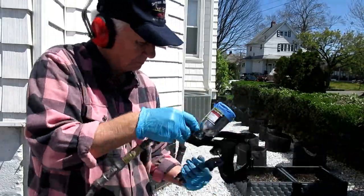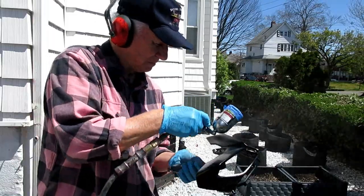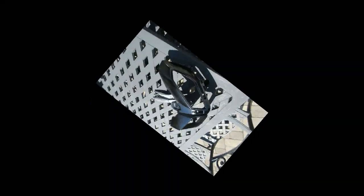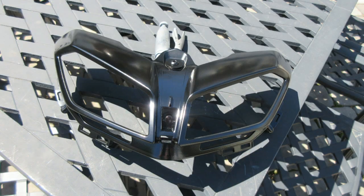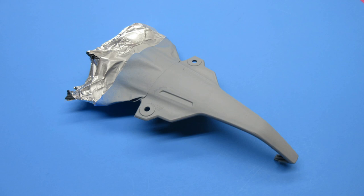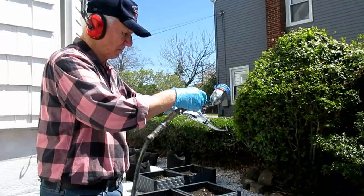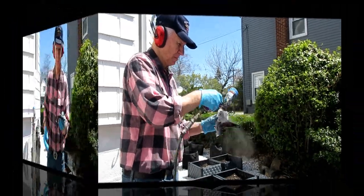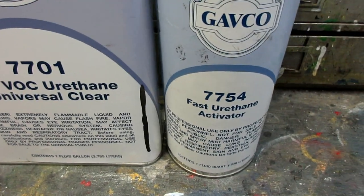I had some black already mixed - here we are, got the headlight shell. Notice how thin the coats are - it's like an airbrush, you almost don't see anything coming out of the gun. I want that paint to lay down as flat as possible. Applying paint in thin coats is one of the ways you stack the deck in your favor - you're not going to get a run because it dries just a little in between coats.